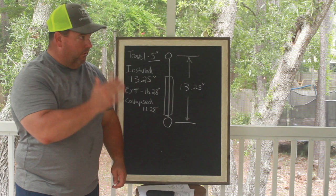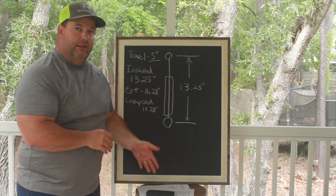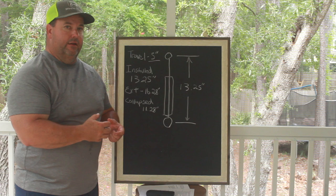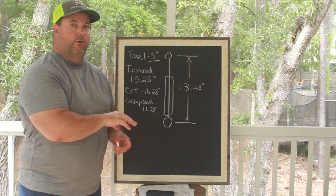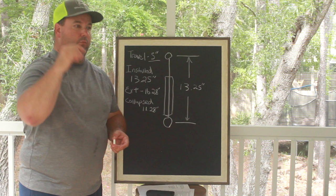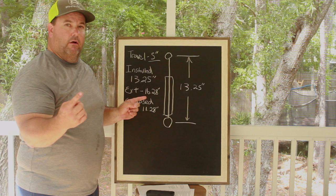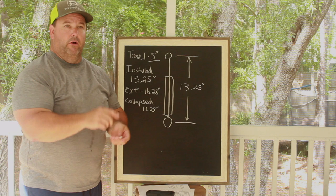I'm going to ask: are you preloading your four-link already? I'll also want to know, does your car go straight today? Does it drive left, does it drive right, or does it track pretty straight? That's something I'll ask up front. There's a website I'll put in the description where you can enter these measurements, and if you share those results with me, that's even better. For ladder bars, I'll still want to know the mount point for the front, the two measurement mount points for the rear, the spread on the rear, and the length of the main ladder bar and top bar.